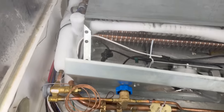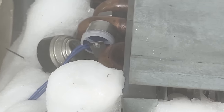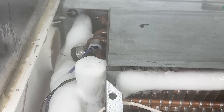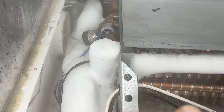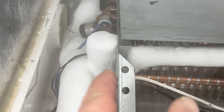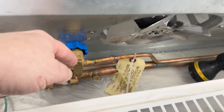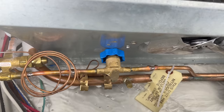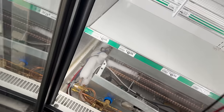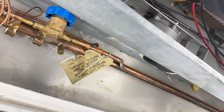Alright, so I got them cleaning that up today, which makes it a little easier. Right here are your terminations — you can see one of them's not even strapped to anything, the other one's hooked on there. It's hard to say which one's which, but sometimes one's for the electronic side of things, one's for the hard wire. We're going to try to melt that last — that way these heaters continue to run, helping me out while I'm doing the water. Notice some yellow here on some of the snow — that could have been from a leak most likely. So we're going to check that with the leak detector and check these other defrost heaters before we get it too warm.